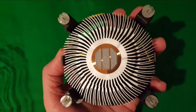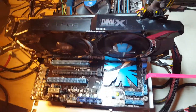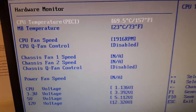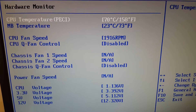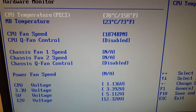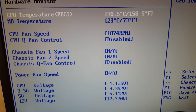Let's have a look at the thermals from this. With my test bench already up and running, you can see the fans are spinning and the CPU fan is spinning as well. When we look in the BIOS hardware monitor, we have temperatures hovering around 69–70°C. Keep in mind that's under no load, so that's telling me it's running pretty hot with an Intel stock cooler.